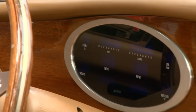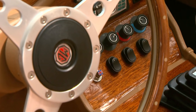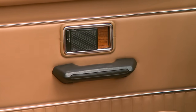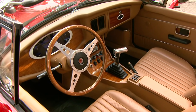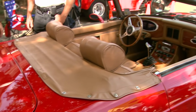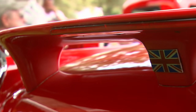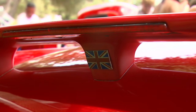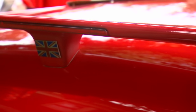You painted the cover back here too? Yeah. How about the wood grain — that wasn't there originally? No, I bought some veneer, cut some sheet metal pieces and bent them to the contours, got them to fit, and just used adhesive to stick the veneer to the sheet metal and install it in the car. Yeah, it just looks great. I like your mirrors — what are they from? Oh, they're aftermarket. And is this an aftermarket spoiler too? No, the spoiler is actually out of the junkyard — I got it off the back of an Acura. I had to narrow it and build the pylons; I built those out of fiberglass, and it was a good bit of work to get that to fit right.